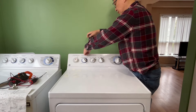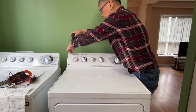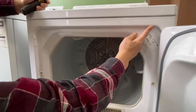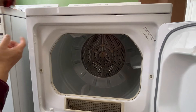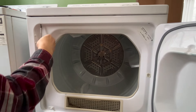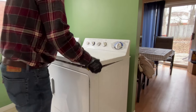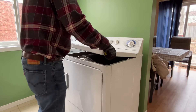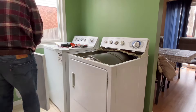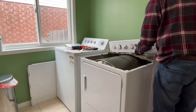Take off the four mounting screws for the control panel on top of the dryer. After that, open the door — you can see two long screws there mounting the top panel. Remove the two long screws, and then lift up the top panel, wobbling a little bit, about 20 degrees, and gradually take it out. Then flip over the control panel upside down.